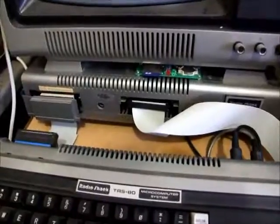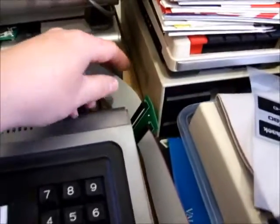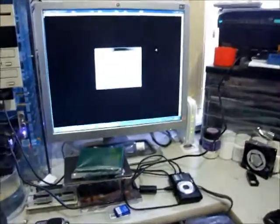Okay, so here is our serial cable. There's the adapter there, neatly out of the way. It's connected to an incredible array of adapters, but it works. You probably wouldn't use that many, but mine goes DB25 to DB9 to DB25 again, which changes the sex, then to a null modem, then to a DB25 cable, which goes under my desk to my PC, and it works.